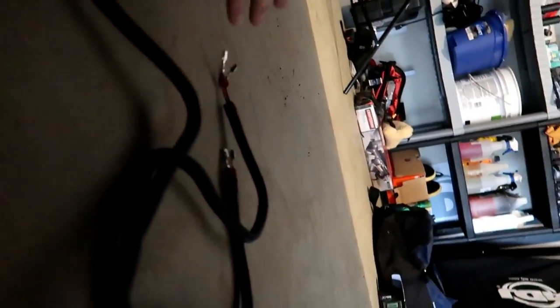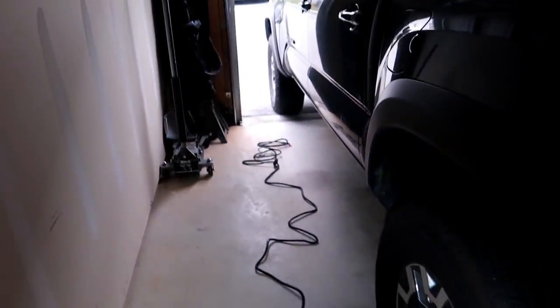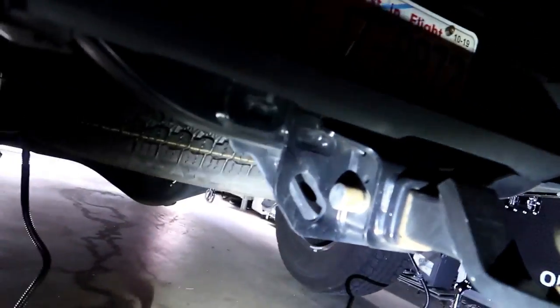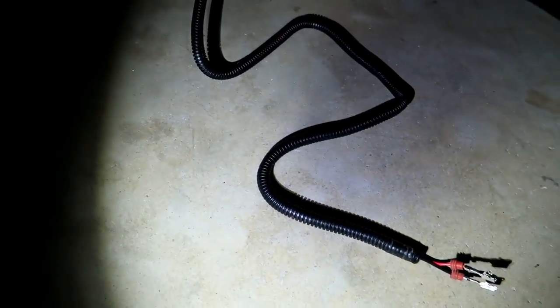This is the part I was talking about — look at how long these wires are left over. What I'm going to be doing is grabbing the main loom, figuring out where it's going to go and how long these need to be so I can cut them, crimp the ends back on, and have no slack so it's nice and clean. That's way longer than what we need. I'm going to keep these ends, figure out where to mount them underneath, figure out how long they need to be to get there, then take those crimp connectors off, cut the wire back to the correct length, and cut the wire loom and guarding to the correct length as well. A little bit of extra effort, but it's going to make it look a lot more OEM and professional.